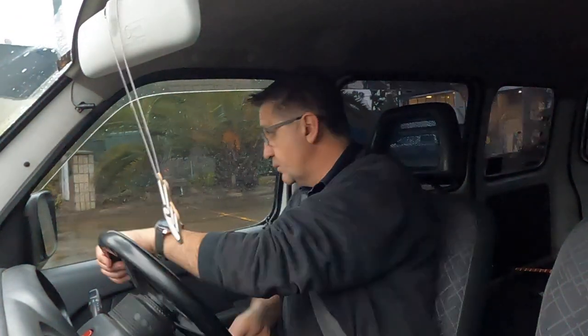It still goes - lights on because it's rainy and crappy outside. The other thing we've got to do, because I stood the camber up, it's a bit nose high at the moment so we'll have to bring the ride height down a fraction. But let's see what this thing sounds like. I'm going to nail the pedal already. Won't know for 100% unless we get up to about 70 or 80 Ks, which we can do out on the main drag. Wet roads are slippery - that wasn't done on a public road, by the way.